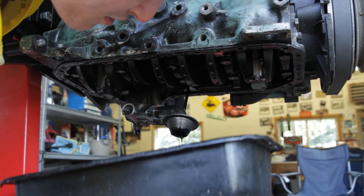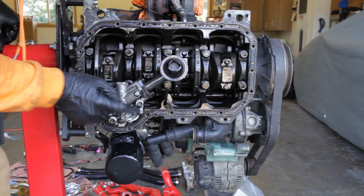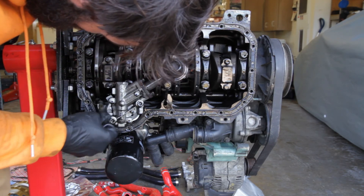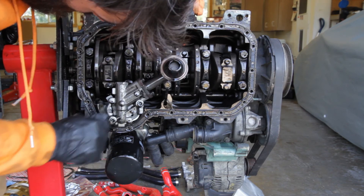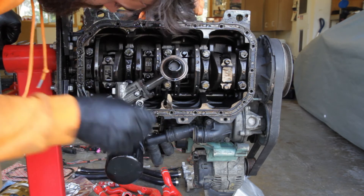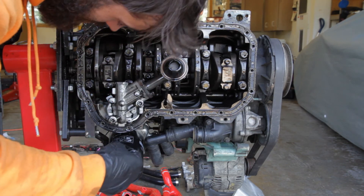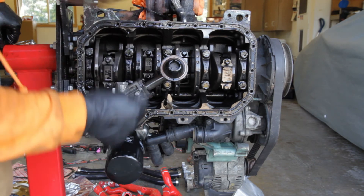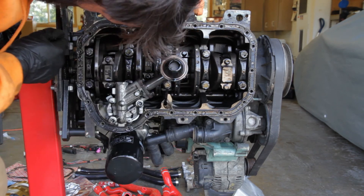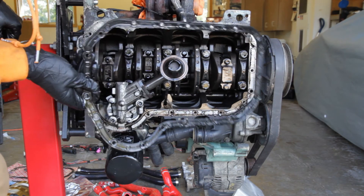So there is our oil pan. Today we are going to be taking off this oil pump right here. They said hexes would work, but these are not hexes — these are Allen. But that is totally fine. We'll be putting hexes in there, it literally does not matter, as long as they're the right spec bolts. It actually probably would have made this a lot easier if we could have used Allens. Literally everything else is hex. So I'm kind of taking off this old oil pan gasket. We'll clean up the seal around here — I'm not exactly sure what most people do for the seal, but we'll make sure that gets cleaned up.